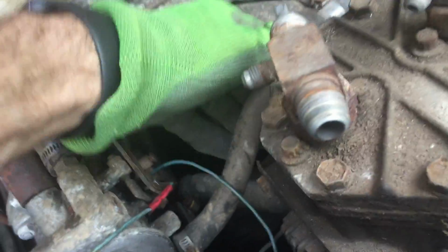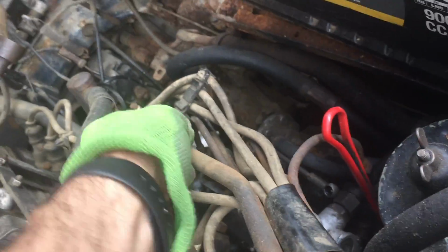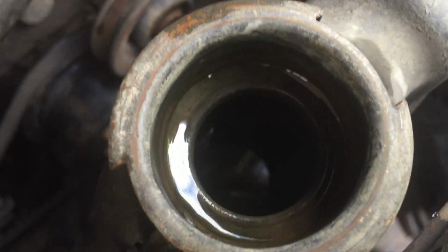And so this here is the coolant loop down there, and I guess it's running up there to the injection pump, and that also is loose right here. But the good thing is we're getting some water through there, and I need to put some more in because there are several leaks, including the heater core is leaking on the inside of the car.